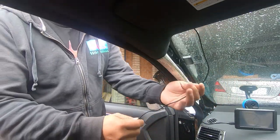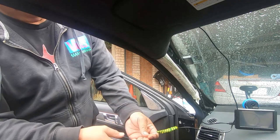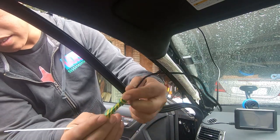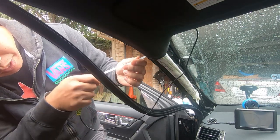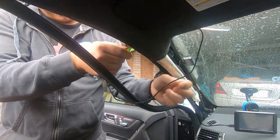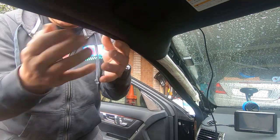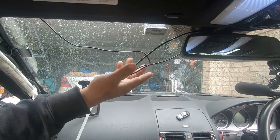Now I'm just going to show you how you get your cable from the top to this side here without having to pull off all this trim. Pull down your weather strip and get a zip tie — a long one. If it's not long enough, just connect two together. Duct tape your cable to your zip tie and push it in through here. This will guide it out to the front. Get it through and pull it all the way through, then route your cable along the head trim. You can easily hide it underneath there.